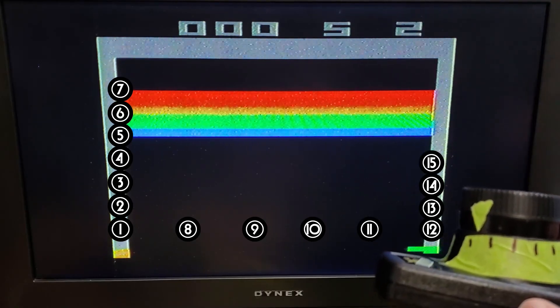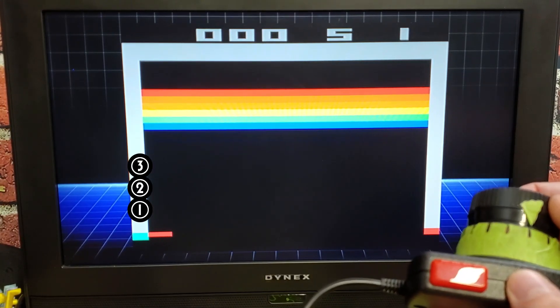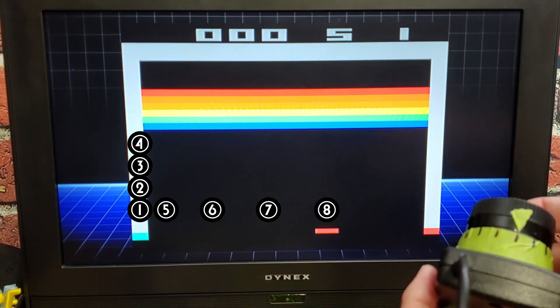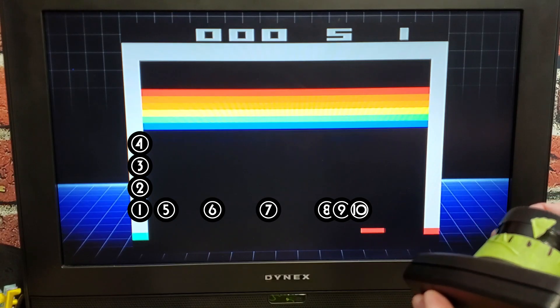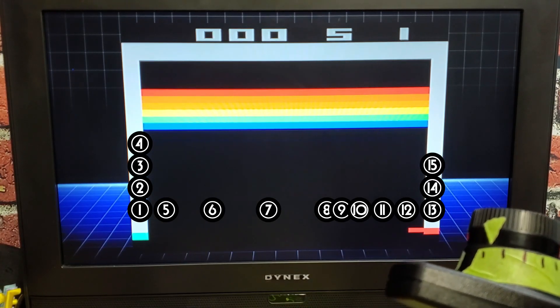As I turn the paddle one centimeter at a time, I'm marking on the screen where the paddle currently is. Don't be concerned that the first few and last few didn't move at all — that's normal, games don't typically require you to turn the paddle the entire 330 degrees. Pay attention to how evenly the numbers are spaced as you move across the screen. These AT Games paddles work really well when talking to original hardware that reads the analog data as intended. Now let's plug this same controller with the tape rig into the Flashback Gold — the first few numbers just stack up on the side, outside of the testing range, but then as the paddle starts making its way across the screen, it starts out pretty even and then just past mid-screen the numbers get all bunched up.